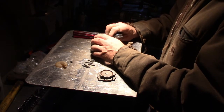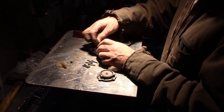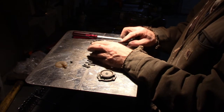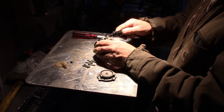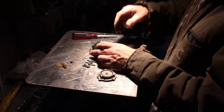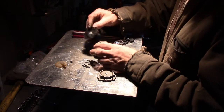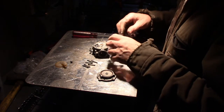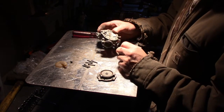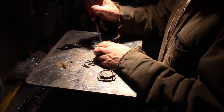Expected something, so expected to see something like, you know, obvious. And it could be just the needle in the seat's got something dirty clogged in there. Doesn't appear to be that dirty. I'll be damned. But we're gonna go ahead and take it apart anyways and put some new parts in.